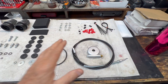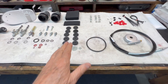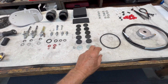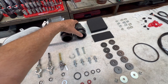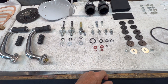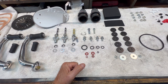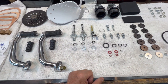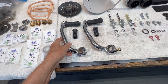The client has asked me to install a new speedometer drive and speedometer cable, so I'll do that tomorrow. This is a new tank mounting set — cushion rubbers and mounting rubbers — we'll use that. This is the tank mount for another style tank that we don't have on this bike. This is a nice set of small air cleaners; we'll talk about putting those on instead of the stockers. Two new petcocks and a third different style. These are studs for the foot pegs, which we don't need.